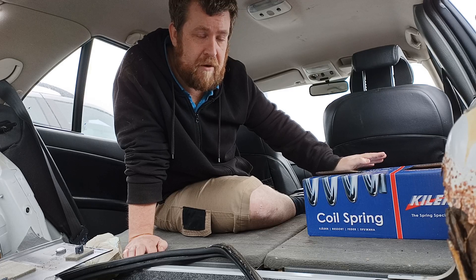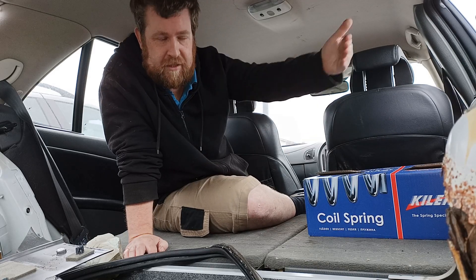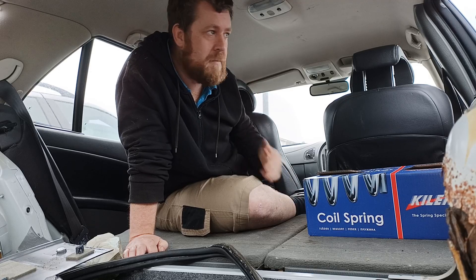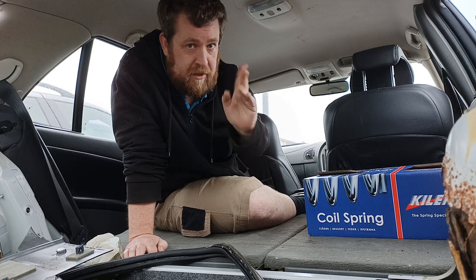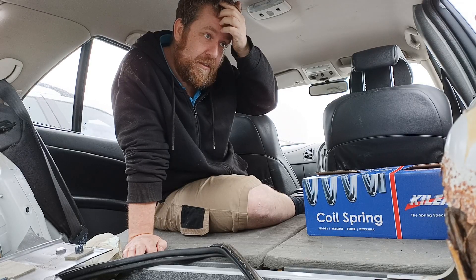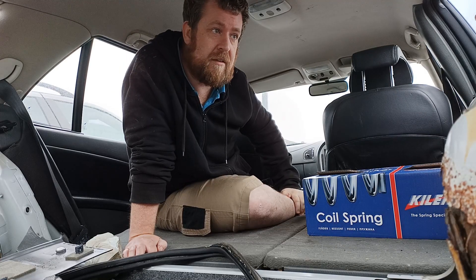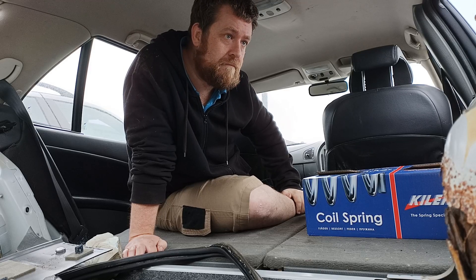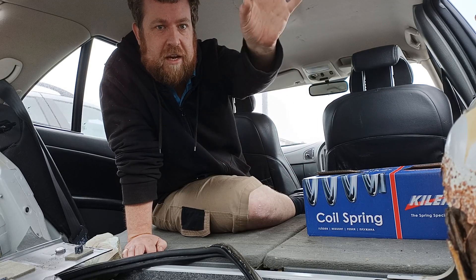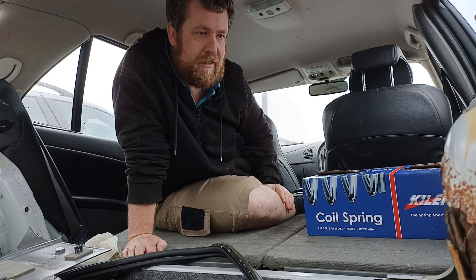The weirdest thing about this car is that both the rear dog legs are fine. I had used that as a kind of proxy to the state of the rest of the car underneath in that area, because I know 9-5s — they're prone to having their dog legs bubble up. This car: absolutely fine. It's possible it's had work in the past; I've only had it a year and it's a 20-year-old car — a model year 2002, registered in the latter half of 2001. It's still a bit of a shock to discover that this has been rusting away quietly. Maybe you want to take those rear wheel arch liners off and have a look at the actual condition.